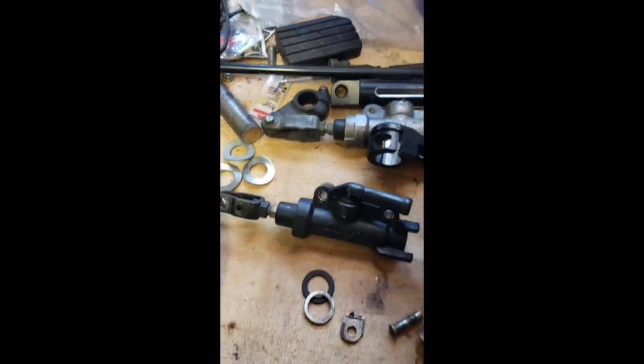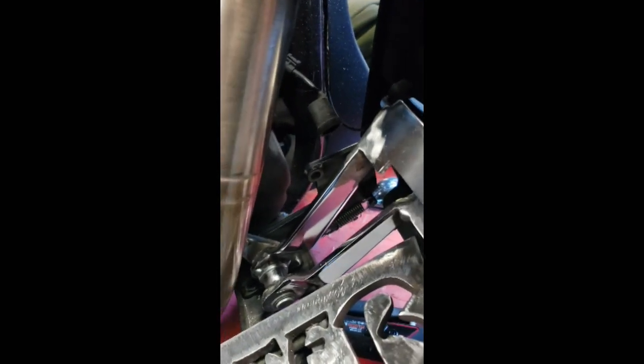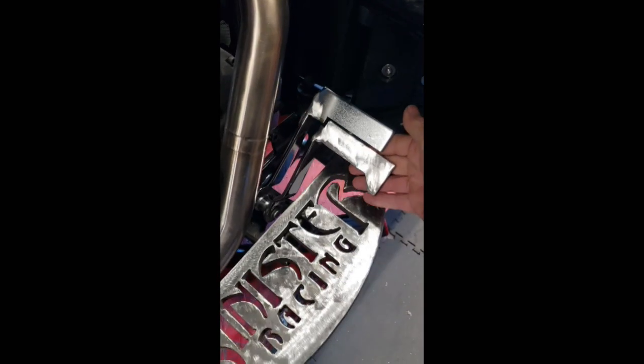It's going to be a question of how tight this is going to be to the end of the master cylinder. I've got a couple of aftermarket ones, and then I've got a couple of different ones — one's the Road Star one, one's a Road Liner or one of the other Star bikes — so I can play with those. For the rear, I'm going to have to do a remote reservoir, which I'll probably put back here somewhere underneath. Once I figure that out, I'll determine where to put the actuator. For the front one, the actuator is going to be right here — it's already attached to the lever. For the rear, I'm going to have to put it somewhere else — it'll probably be cable operated. I think that's how I'm going to have my pedal set up.